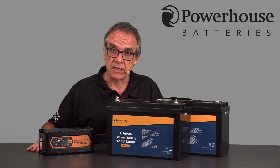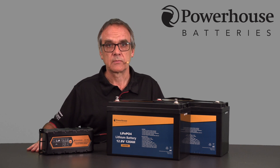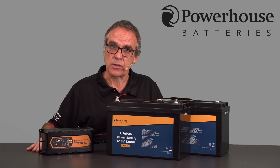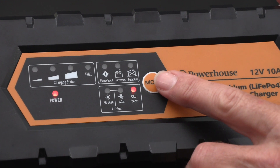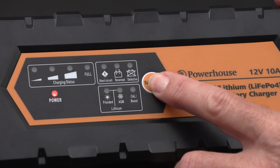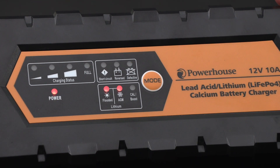This could lead you to believe the battery is dead or faulty, but it is not. To recover from safe sleep mode, completely disconnect the battery and use a mains lithium battery charger with a wake circuit. This will pulse the battery, eventually getting it to begin the charging procedure.